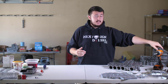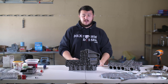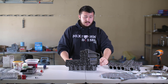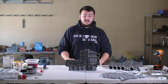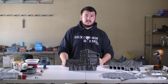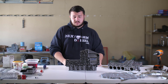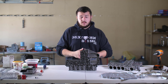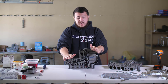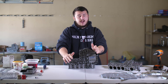To begin, we take a 68RFE valve body and we remove absolutely everything except the detent and the manual valve. Everything else disappears. The entire valve body gets completely broken down. Now some other competitive manufacturers take the valve bodies and break them down and do their rebuilding process, but a lot of OE components tend to find their way back in, such as low reverse switch valves and things of that nature. We've found that anything that potentially produces an issue just simply has to go in place of something better. Manual valves are not a problem in this transmission so we keep them in place.